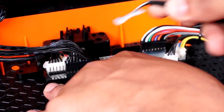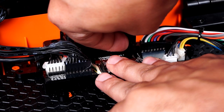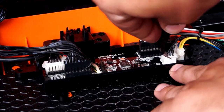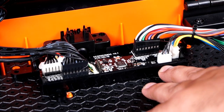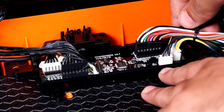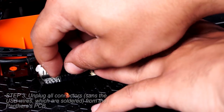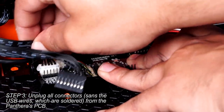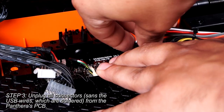Regardless of the amount, all connectors need to be deglued. You can do this by picking away at the dried glue with some fairly sharp tweezers. This doesn't take a whole lot of finesse, but do be careful around the USB wires because they're hard-soldered to the board. Take your time here, especially if you're contemplating reusing the control PCB for another purpose. Try to avoid tugging on individual wires — it's better to pull on multiple wires and one connector for even support.